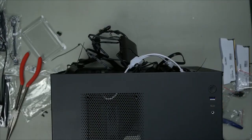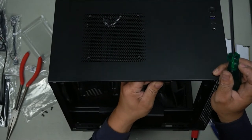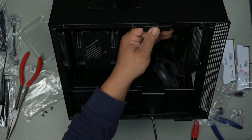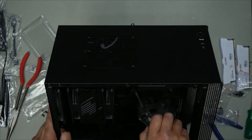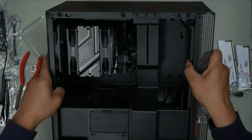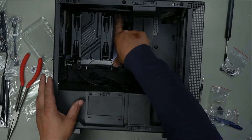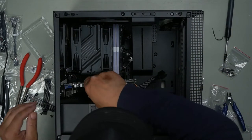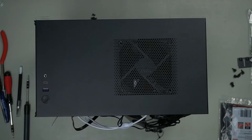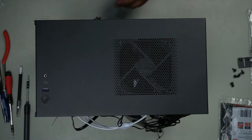I'm just going to lock in our cable management. Little screw that goes in at the top here and at the bottom, same spot. One here. This can be removed to adjust your cables. Our fan can go back in now. Let's give it a test run before you go any further to make sure everything works as it should. Put in our trial graphics card. Give this a quick try and make sure everything works, everything lights up as it should. Right, now with the quick test run done, I'm going to reinstall all the fan screws first, top and bottom.